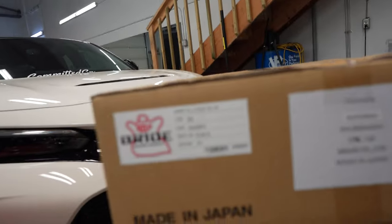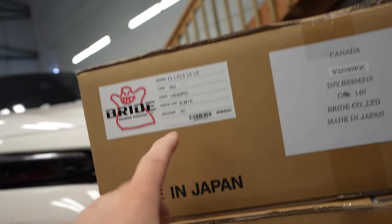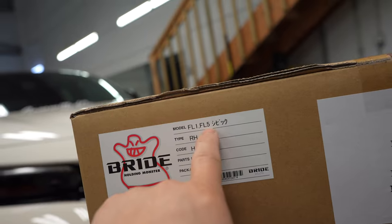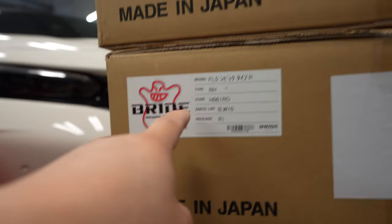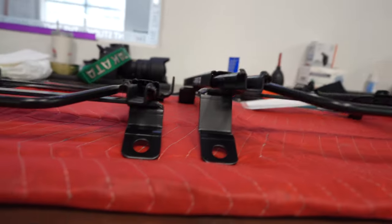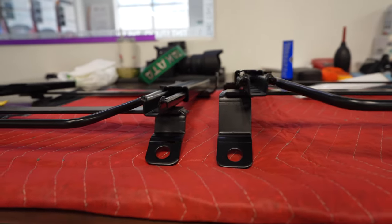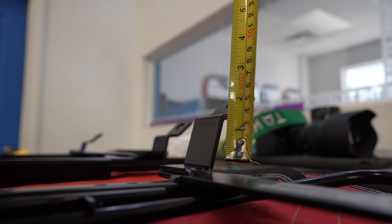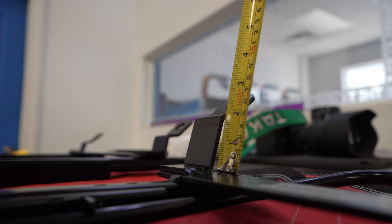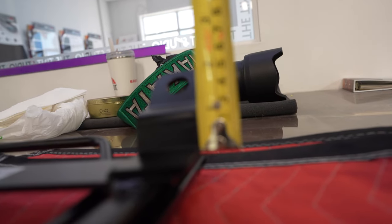Here are the part numbers. The one for the normal seating position says FL1 and FL5, and the one that is considerably lower says FL5 only. Here's a side-by-side shot — there's a noticeable difference. That one inch could matter depending on your preferred seating position. For the technical guys: the standard rail measures roughly two inches and the FL5 low rail is roughly one inch, so you get about an inch more height with the standard seat rail.